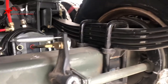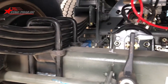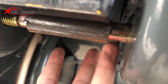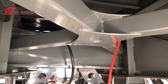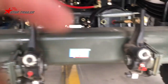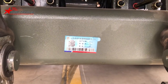Here we can see the leaf spring — we have a special leaf spring for the dumping trailer. It's a 4-length leaf spring with only 4 pieces. That's the ABS sensor line. Here it always has protection to prevent wear on the bolt. This is how the trailer is reinforced between the two left and right main beams. In the China market, we use the automatic slack adjuster, which is not necessary for other markets because it's more expensive. And here is the label for the axle, showing where it was made.